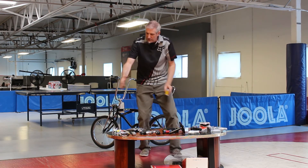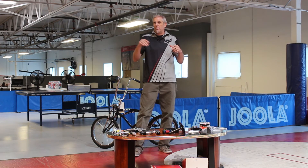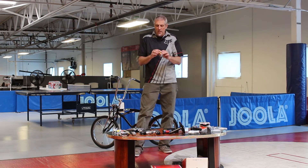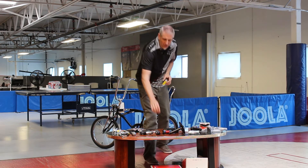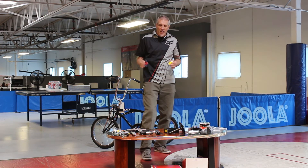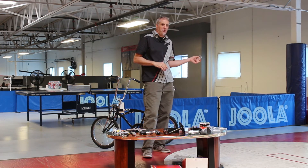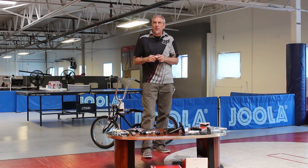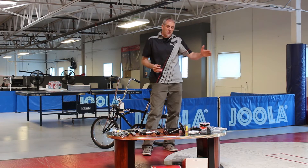That's basically the evolution of the bottom bracket. There are adapters and all kinds of things to fit one style crank to another. For example, this adapter presses into a BB-30 bottom bracket but allows you to run a cartridge-style bottom bracket in it. So if someone has a pair of cranks they've had for a while but bought a bike with a BB-30 frame, they can buy one of these, press it in, and use their existing cranks.